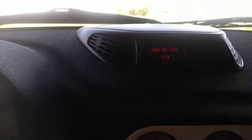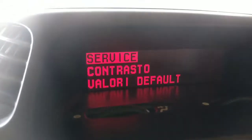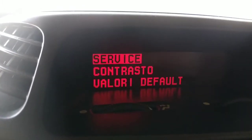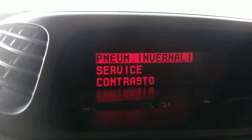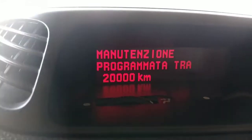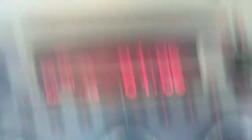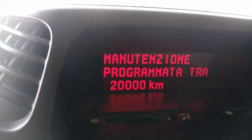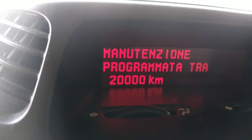I hope you like this small tip. One last thing to say here in the service menu: if you want to reset your service, you enter the menu, select service, enter your service, and imagine you have a number there. The way to reset it is to press and keep pressing plus and minus simultaneously. In a few seconds you will see the LCD flash for half a second.